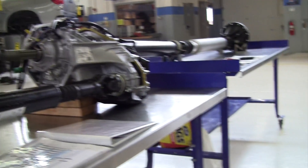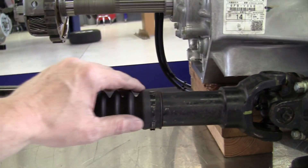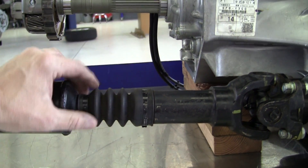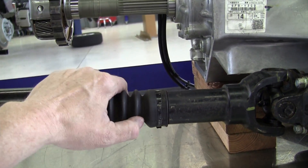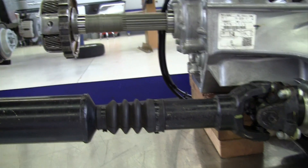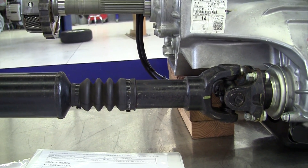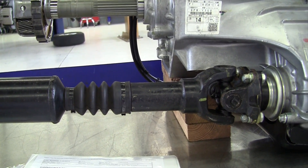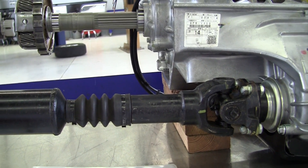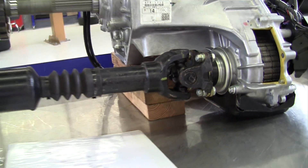Now, you as a technician can actually cause these to be out of phase if you're not careful. Right here on the front propeller shaft and on the rear propeller shaft, sometimes there's a slip yoke. The slip yoke is under this rubber bellows here, but it has a bunch of splines. If for some reason that front or rear piece gets pulled out and you just slide it back in any old way, you could set up a second-order propeller shaft vibration — 2 shakes per revolution — if this U-joint bearing cap is not lined up with this bearing cap. They need to be lined up, and you need to watch that when you put it together.